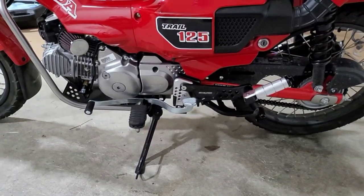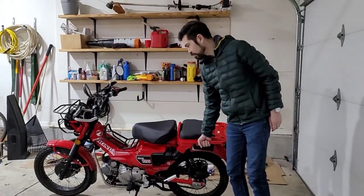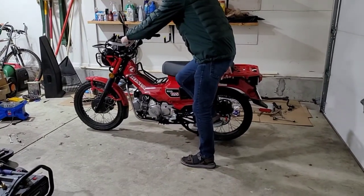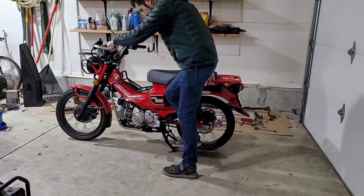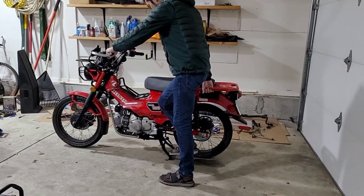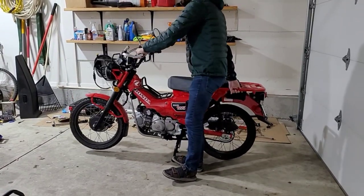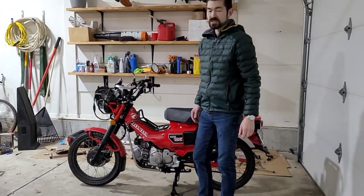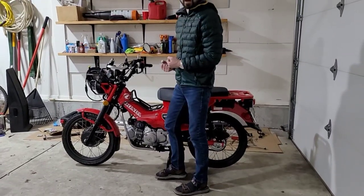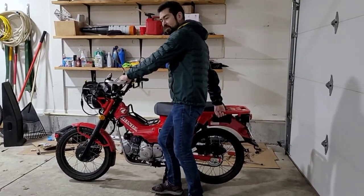I will demonstrate the procedure. With this Honda Trail, it actually has a really good grab position here, so I like grabbing this with my right hand. First, I'm going to get it off of its side stand and flip that out of the way. Then I'm going to drop the center stand, and rock it ever so slightly so I can feel that both of the feet on the center stand are against the ground. Then while lifting here, I'm going to push straight down with my heel, and it'll push the bike right on up. Very simple with this bike. As you get into heavier and heavier bikes, it's a little bit harder, but basically it's the push down motion that really puts the bike up onto its stand, not necessarily lift up. I use this position mainly to make sure I have good stabilization.